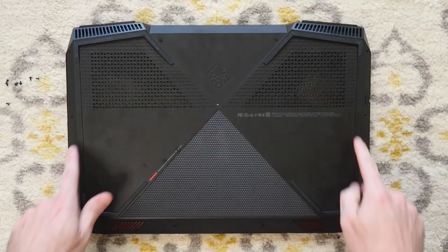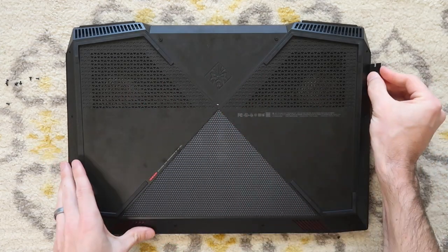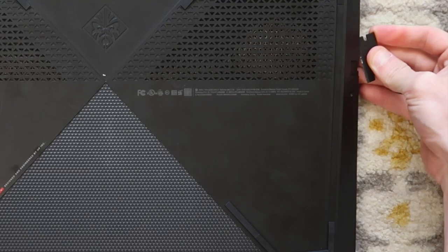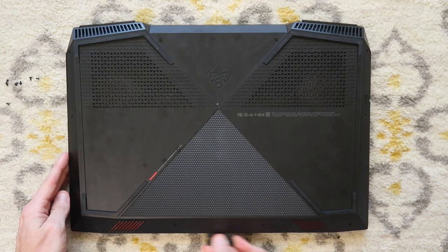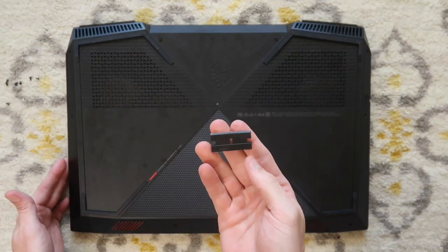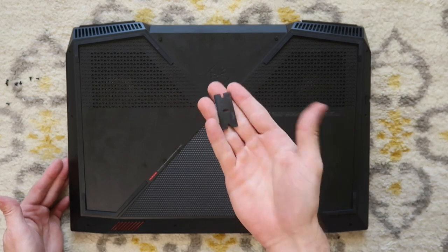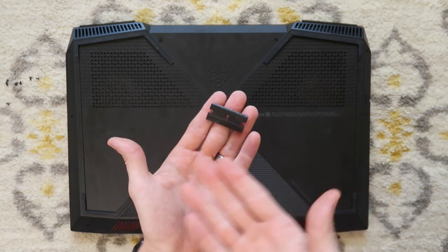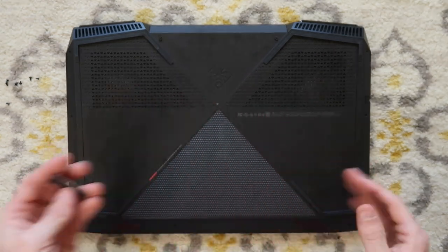And once you get out all 10 screws, you want to take something small, thin, and plastic and run it between the bottom case and the upper of the computer, and it will start releasing clips. I like to use these little plastic razor blades. I have a pack of 100 of them that I got off of Amazon. I will put a link to them in the description. I use them for a lot of things, from scraping off stickers to opening cases. It's sharp enough to assist in certain places, but it won't scratch plastic like a metal razor blade would.